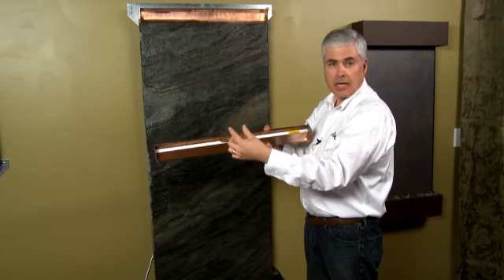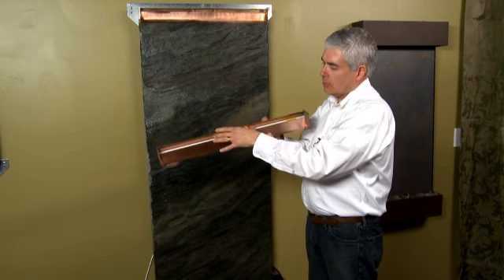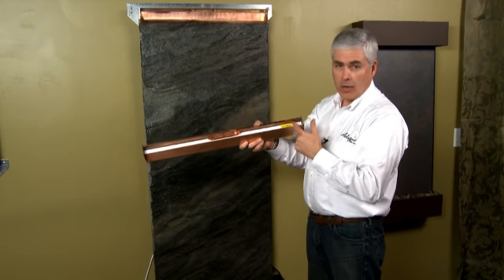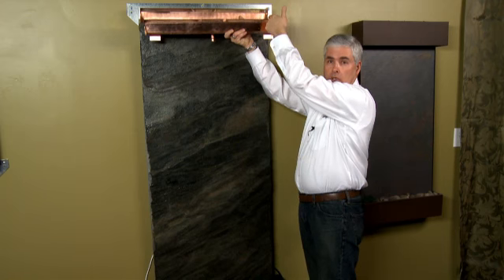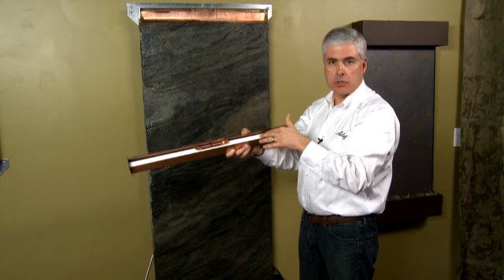the water could be coming out right here at the top of the fountain and splashing out. So it's important that you take a look and make sure that the white plastic baffle, where the arrow says pointing to the wall, is indeed pointing towards the wall, and that the top of the white plastic is squared with the water distribution unit.